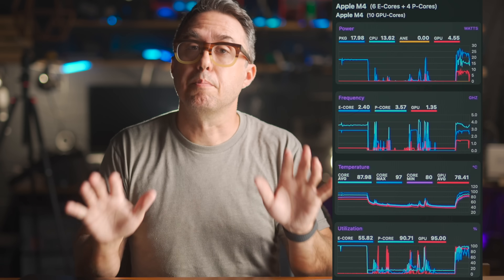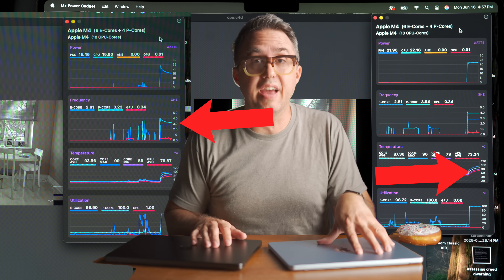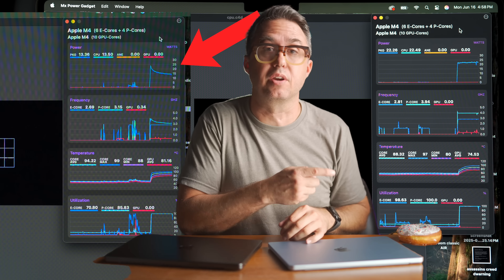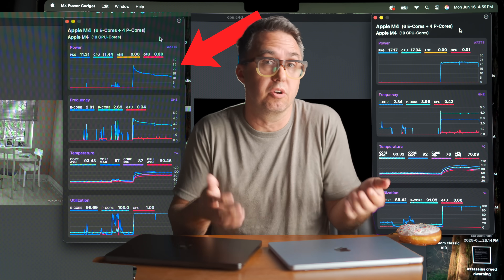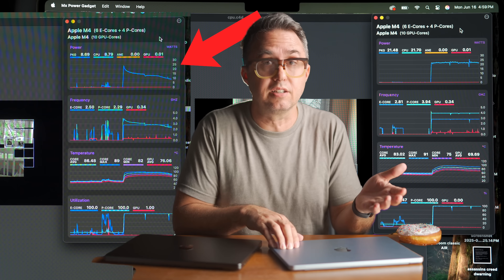First, a baseline test. I'm going to do two things just to have more data: a Cinebench test and a batch Lightroom photo export. Both of these things will do pretty much the same thing to the computer — CPUs pinned to 100% for several minutes straight. To explain what's happening visually, I'm using software called MX Power Gadget. This lets you look at temperatures, processor speed, and total watts — the total amount of electricity these computers are allowing themselves to use. Importantly, the cooler the CPU remains in either computer, the more power it's going to let itself pull out of its battery, and therefore run faster. Time is sped up here — you're going to see a five-minute test over the span of a few seconds. You can see basically immediately after starting a Cinebench test, temps on both computers just shoot up, and in response the CPU on the Air quickly starts to ramp down. The watts — the amount of power the MacBook Air is using — goes down, because electricity is converted almost perfectly into heat after doing the work on a computer motherboard. The MacBook Air is trying to limit the amount of heat it's creating to match the amount of heat it's dissipating.